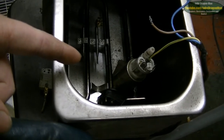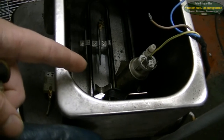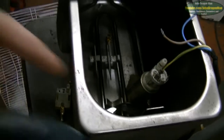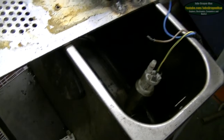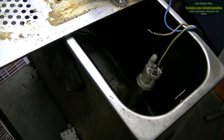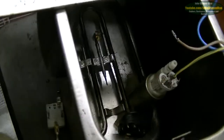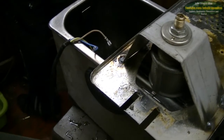The oil pump — what we've got in here is a pump off a Fiat Punto Mark 1, 1.2 litre engine. I think it was the 16-valve it came off. It's a 2 bar pump. That's 2 bar — about 30 psi it runs at. It's about 15 psi per bar, or 14.8, something like that.